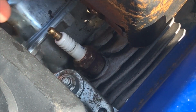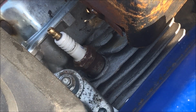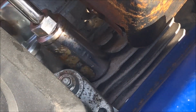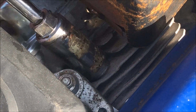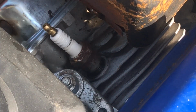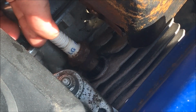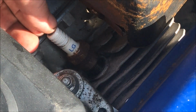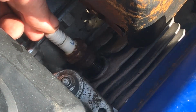And you take this, get yourself a spark plug socket, the right size. That should be a deep well. Just throw it on there. And well, she was a little loose already, so that makes it a little easier too. Just pull her out. Stick your hand in there. You want to do this with the engine still cold, because see, that says hot. That's the exhaust, and that'll get real hot because it's burning out exhaust. Kind of simple stuff.